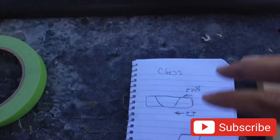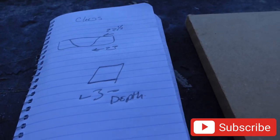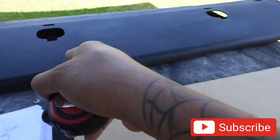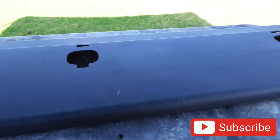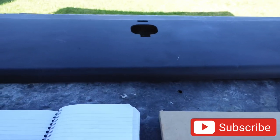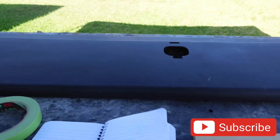When I did the consultation with my boy, I took the liberty of measuring out his seat to see what the clearance was. The top we can come in 22 and a half inches and the bottom part we can come in 23 inches. I'm going to take my tape measure, mark out 23 inches on one side and 22 and a half inches on the other with wax pencils, tape off the line, draw it with a pencil so I know where I'm working — that way I can stay in that area and know exactly how much space I've got to work with.